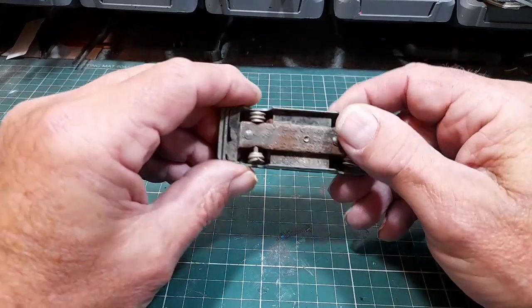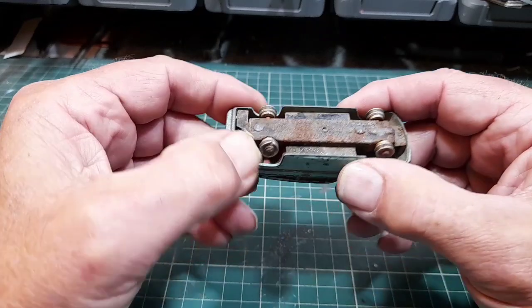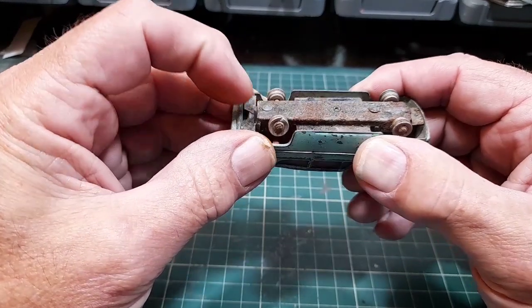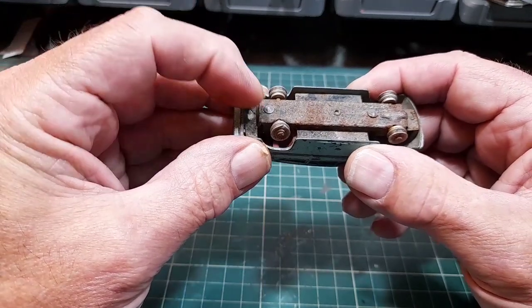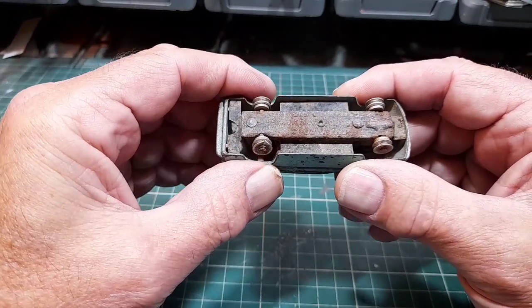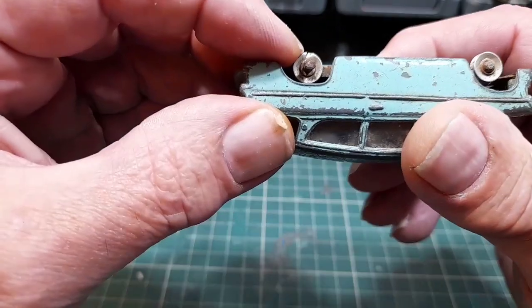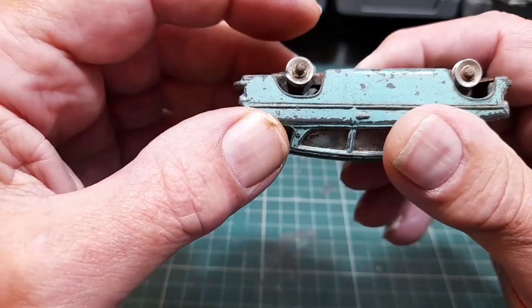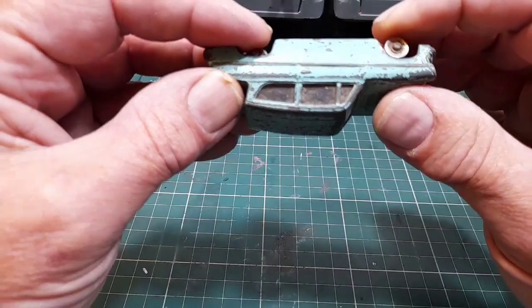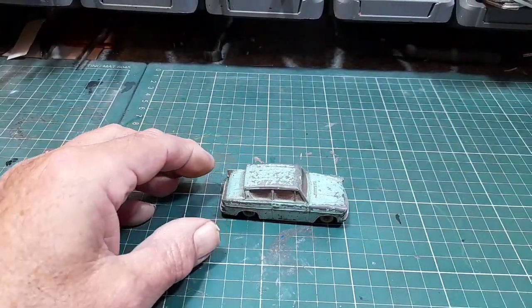Okay, right, enough of that. Let's get on with it. Let's get it out. There's two rivets there. They're domed, so they want filing a little bit flat, and then the automatic punch on there to get them out. This wheel's a little bit knackered there. Look, it's got a chunk out of that wheel. You see that? Somebody's curbed that. Suspension's not too bad on it. Right, I'm going to get these rivets out and then we'll have a look at it.